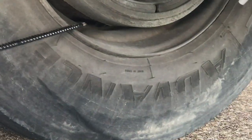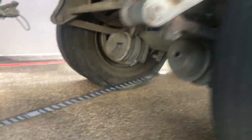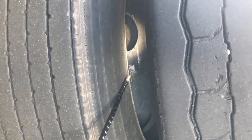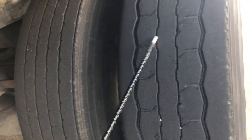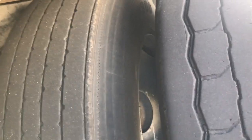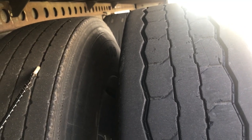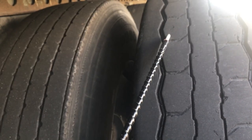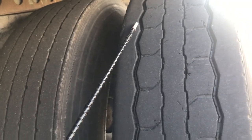Here you have your rim. You want to check both the inside and outside of your rim — make sure it's properly mounted and secured, not cracked, bent, broken, and free of any illegal welds. In your tandems, there should be zero space between rims, and make sure you still have at least three inches of tire space between tires. Anything less indicates low tire pressure or a flat tire. These can be re-groove or retread tires — no less than 2/32nds of tire tread depth. Check your sidewalls on both dual tires for no abrasion, bumps, cuts, dry rot, tears, or frays. These tires must be at least 100 PSI or to factory specs.